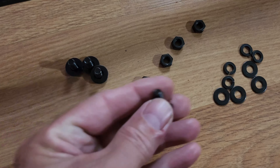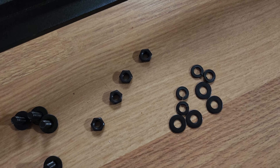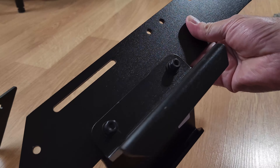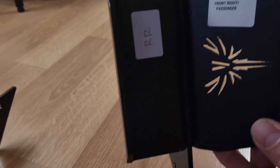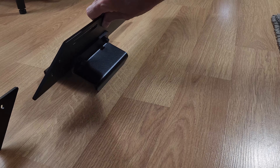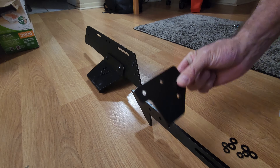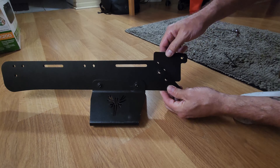The kit comes with the necessary hardware. Cap screws come in three sizes: half inch, three quarter, and one inch length. Begin assembly by pre-assembling both sides — note the washer stack: one flat washer between the plates and hardware, and a lock washer directly underneath the nut. Leave this assembly loose until final assembly on the truck. Both inner and outer clamp plates should be labeled for which side they're to be mounted. With both rear clamp pieces pre-assembled, join the main side rails using the joiner plates — both left and right side pieces are identical.